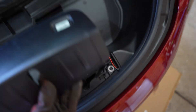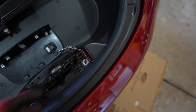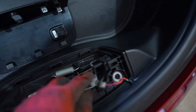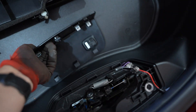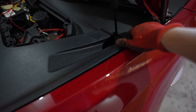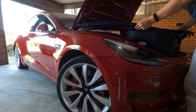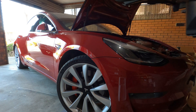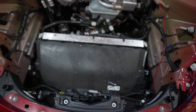You do want to disconnect your frunk emergency release button here — this purple cable. I also have an aftermarket LED strip so I'll disconnect that too. The purple and gray cable stays with the car. With those disconnected, you can pop the frunk liner off — it's just held on by clips. Work your way around and start pulling it up, and you'll see it lifts straight out of the car. Make sure you disconnect that purple cable, otherwise you'll be pulling against it when removing the frunk tub.